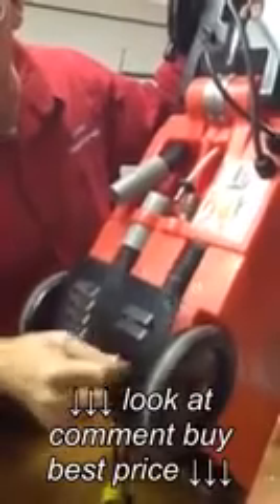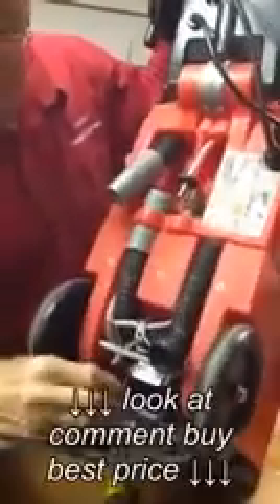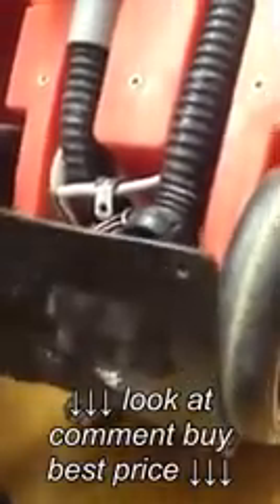As far as the pump is concerned, it's a little more difficult to get to. You have to remove this hose — there are several ways to do it. What I do is take a screwdriver and pop the flange in and pull it out; it's pretty simple to replace. Here's the Rug Doctor pump. You have to remove these hoses first, and then you can pull the pump out. The pump that we sell is a better quality pump — it's a flow jet — and it'll fit in there quite easily. When it's time to reinstall it, you just screw the two elbows out, put the pump in place, screw the elbows on, hook the hoses on, and then you're good to go.